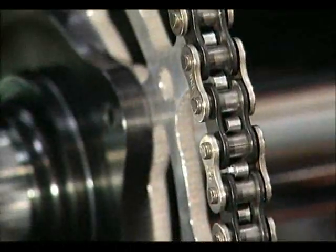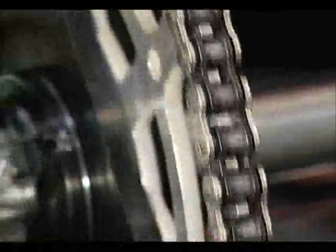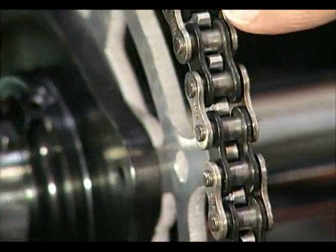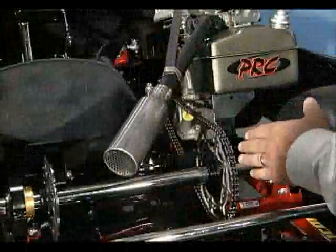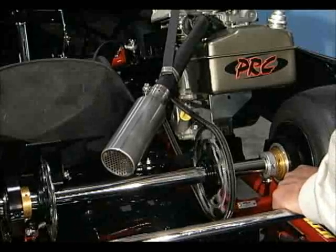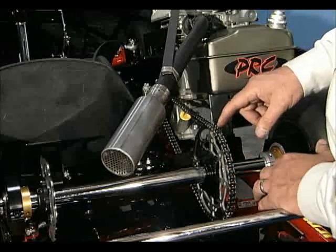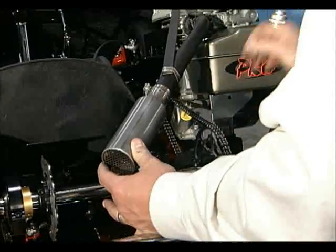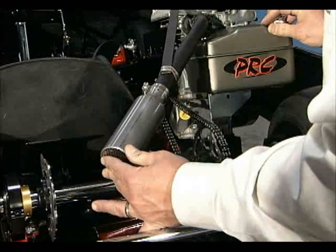That wasn't enough — go some more. Now you can hear it's starting to hit my chain guide, so I need to move my chain guide over a little bit. Now it's running in the center — the sprocket's running in the center of the chain. So I want to tighten that down. Now my rear gear is lined up. We want to make the chain run in the center of the sprocket. It doesn't matter if it looks out of line as long as the chain is running in the center of the sprocket — that's what you want. Now we want to align the chain guide up to the chain because the chain is where it's going to run; we're not going to move the rear gear anymore. Finish snugging the motor down to make sure it's in the right place.